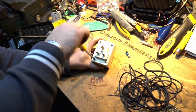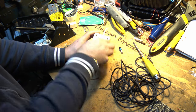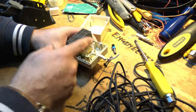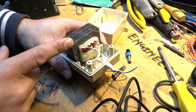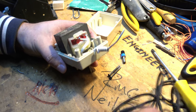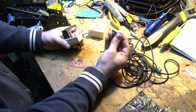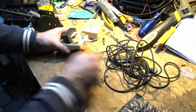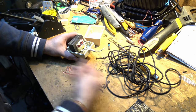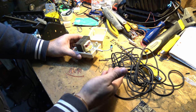Let's get the screws out of this bad boy. The workbench is an absolute mess. I've already removed a couple of screws from this. There are no components in here - this is literally just an AC transformer and it puts out 19 volts AC through this cable to the Acorn Electron. I've got a whole bunch of extra cable and a little DC barrel jack, and what we're going to do is just solder that on there, maybe put a cable tie around there as a cable restraint, and then use a multimeter to check that everything's working before we plug it into the Acorn Electron.